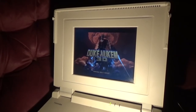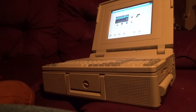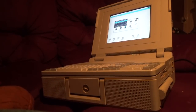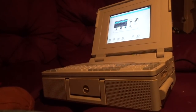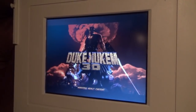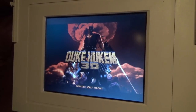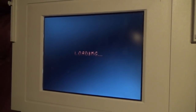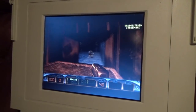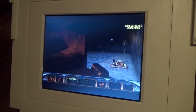The screen is quite large and it isn't a passive LCD — it's an active matrix TFT screen. It has a contrast ratio of 60 to 1, a maximum resolution of 640 by 480, with an 8-bit colour depth — basically 256 colours, though there are supposedly 256,000 possible colours it can display. This is a very vibrant and responsive panel; I'd say it rivals and in some cases surpasses a lot of modern LCDs. The quality of LCDs seemed to subside as we went into the 2000s — I guess that happens when things become cheap and mass produced.